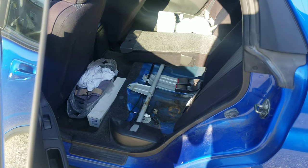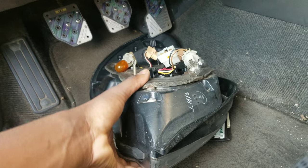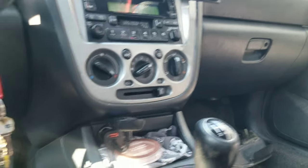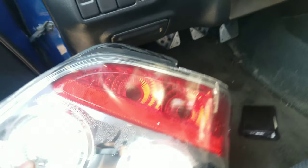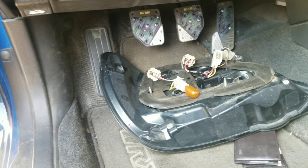I got my back seats out — long story. After you dump the water out, you're gonna want to put your tail lights under some heat. I don't have a heat gun or a blow dryer, so I'm actually using the heat from my car — I just put it on full blast, all the way on the feet setting, blowing into the tail light. And yep, it's clearing up a lot more, so we'll let it sit in here a little bit longer and hopefully it'll be nice and clear.